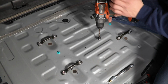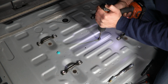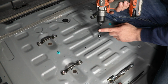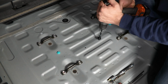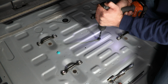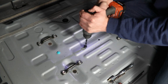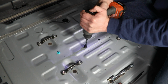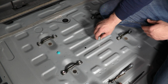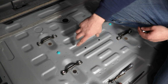Now with my 1/4 inch bit with a drill stop installed. It was a little better, did what it was supposed to do. And then lastly, that provided 23/64 bit. Then real quick, with those holes drilled out, I will just double check, make sure that the riv nut slides down in there and seats fully against the material before coming back and cleaning up all this mess.